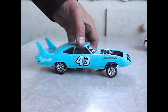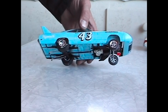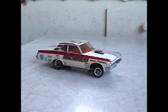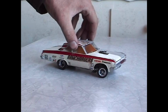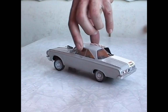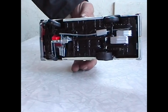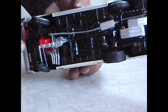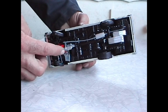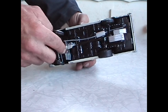But I used to take these cars to contests, and quite often what would happen is the judges wouldn't notice the wheelbase alteration surgery. So I built this half and half car, which basically was designed to make it so you couldn't miss the fact that it is altered on one side, like the Ram Chargers 64 type car, but on this side, it's Grandpa's 383 car. The work continues underneath. There's sort of a half and half drive line. We've got a Dana 60 in the back on one side, an 8 3/4 on the other. Blown fuel or injected fuel, Hemi on this side, 383 4-speed on that side, you know, the dual exhaust system, and then of course the zoomies.